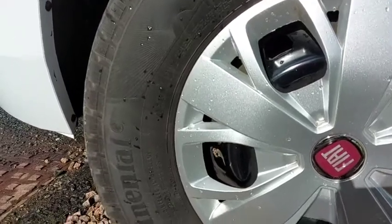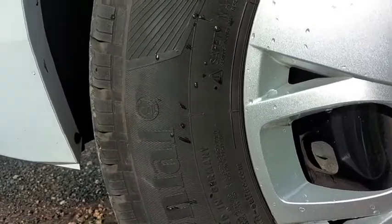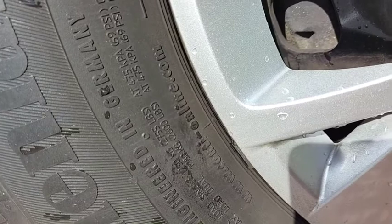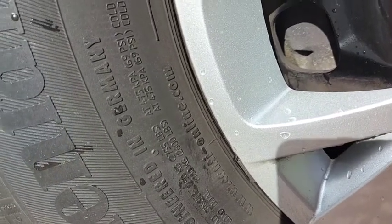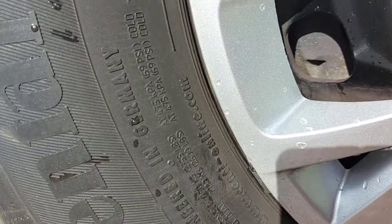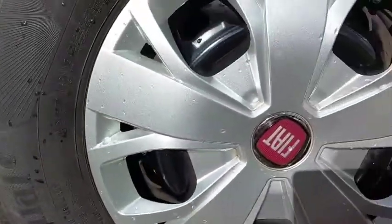The other important thing with your tyres is the load rating. It's here — it'll tell you the maximum load for a single and maximum load on a dual axle in kilos and pounds. That needs to be correct when you get your tyres.